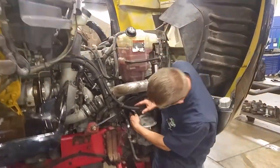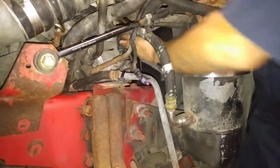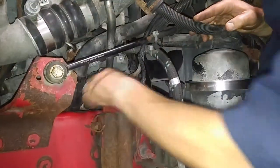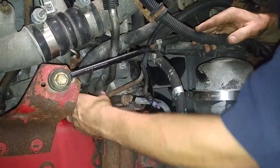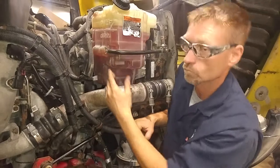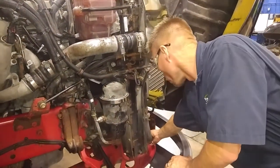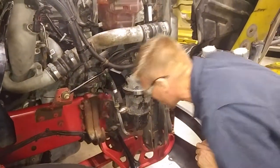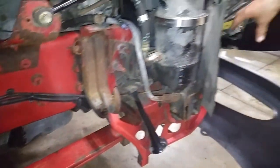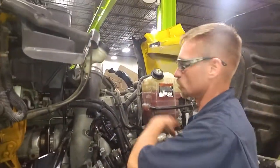The water pump is located in the front of the engine and is belt driven. Your AC compressor is right here, and your water pump is located right here. The inlet valve is located off this forward tube which comes up out of your radiator. There's another tube that comes up out of the radiator at the lower portion. There's also a larger radiator hose that comes up right underneath. The belt drives coolant out of the radiator, up into your engine, and circulates it through the engine.